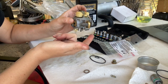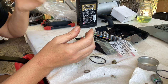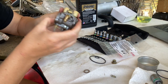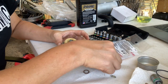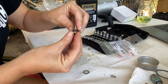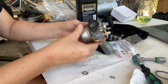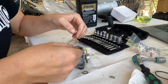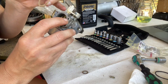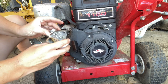I'm going to blow through and check — nothing's coming through. We know that our needle is seating correctly because whether I blow or suck, it does not let anything through. When I bring the float up it's working fine. Now I'm going to put our new bowl gasket on, put the new bowl nut gasket on, mount the bowl nut jet, and then put the gasket on — it has a sticker side so it won't come off. Make sure it does not cover the vent hole.